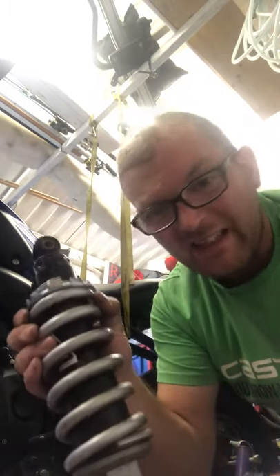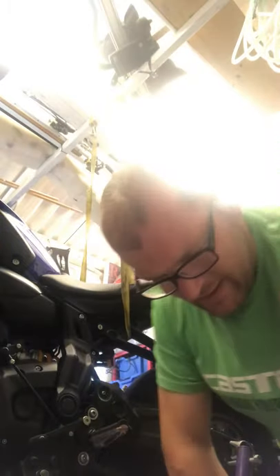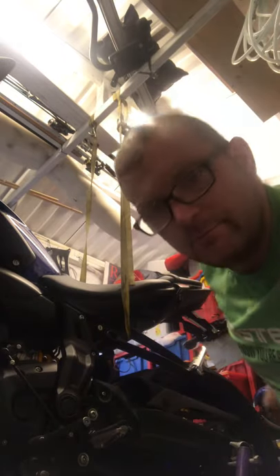You can just tell by the quality of this — this isn't a bad thing to be honest. It's just that the damping in it is rubbish on the MTO7, and when you ride them a little bit exuberantly they'll suffer a bit. Once the hugger thing's on, you can't even get to the adjuster at the bottom. You're going to struggle getting to that adjuster.